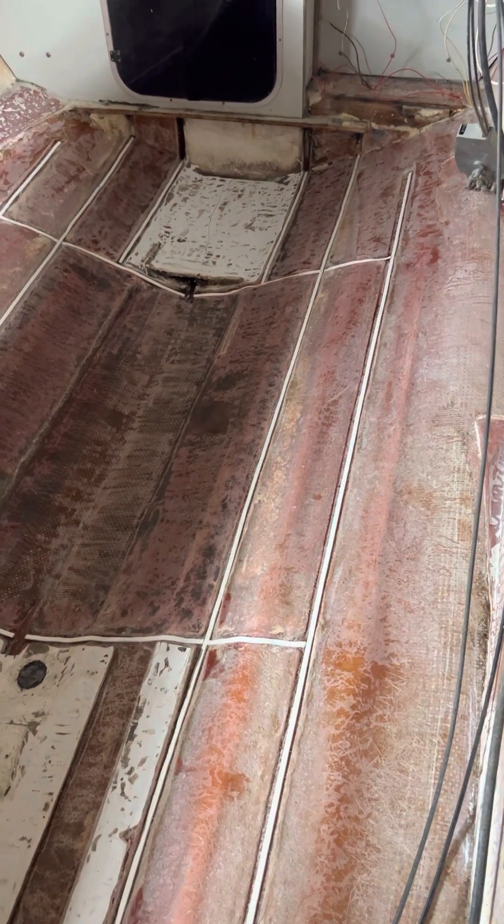Everything has been put in with that white tape. I've seen people put little dots of foam board — that's not how I do it. I'm trying something a little different on this boat. It's about an eighth-inch thick, three-sixteenths wide, self-stick weather foam adhesive. This is what I'm going to do: I'm ready to now create the peanut butter resin and set my stringers in tonight, to get at least the tab-ins of the stringers done.